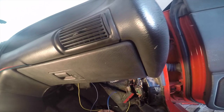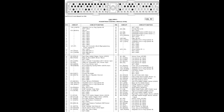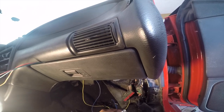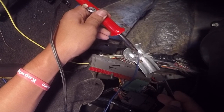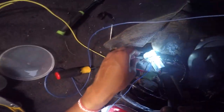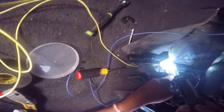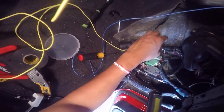Now, like I said, we're gonna get the blue wire and we're gonna put it to the TPS gray and white wire, which is pin number 89. It's in the link in the description, so you guys can be able to see for yourself. But now, time to solder. All right, so went ahead and did it. Seems to look good to me. So I should be done with soldering here at the bottom.